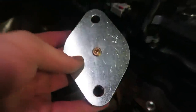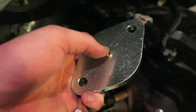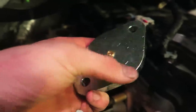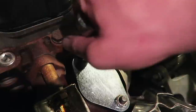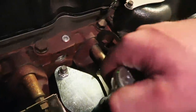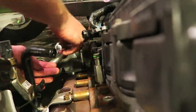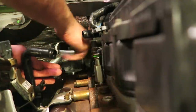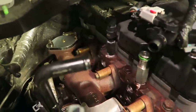It's time to put the plates on. Obviously the one with the EGT port goes in the rear — so when you're racing you can put your probe in there — and this one goes in front. Tighten them down. Next we need to install the coolant reroute and get the crankcase breather reconnected and we'll be good to go.